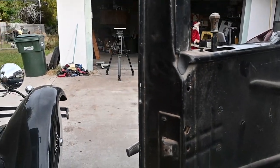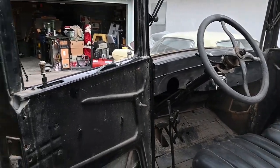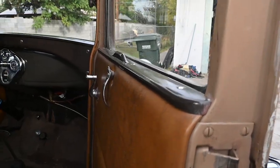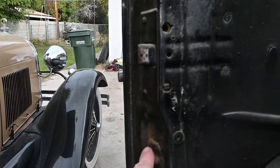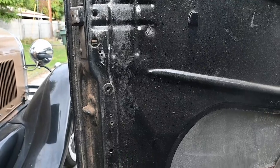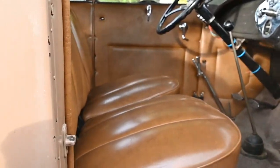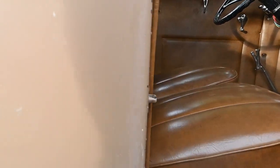Looking on the inside of the door — I have all the panels off because I stripped it down and started sanding it a number of years ago. These door latches are kind of similar, the same idea going on. There's a little post here as a safety feature — if you roll over it'll help keep the door in place. On the Model A they did the reverse: they put the hole in the door and put the pin in the stanchion, the body frame.